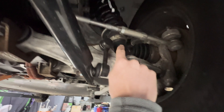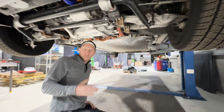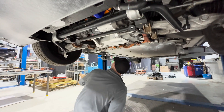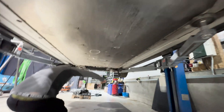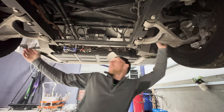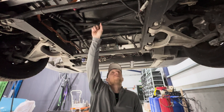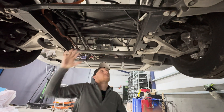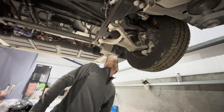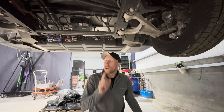Looking up here, these look like they've got coilovers on already, but they're already wound fully down so we're not going to gain any lowering ability from them. Looking at the rear, the subframe is very similar to the front — it's actually got steering arms here with no rack, so we could make it rear-wheel steering. There's a big cross beam which we'll probably have to remove to get the new motor in, but we can always rebuild it. They've also put reinforcing on top of the strut tower with additional bits of steel to make it even stronger, which for a race van is not a bad idea.